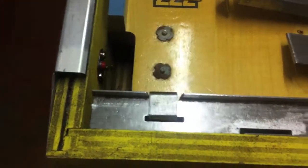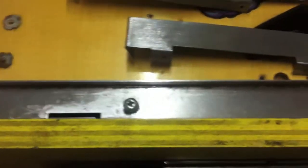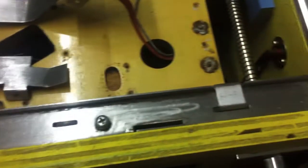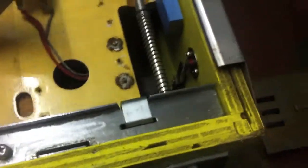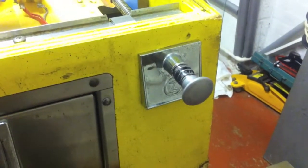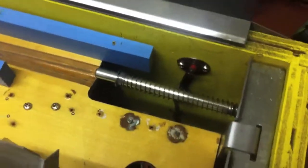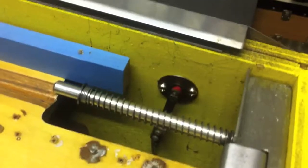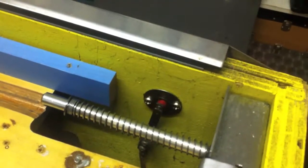I've also done the lock down bar and the brackets. There was quite a lot of rust on the lock down bar assembly — that's all gone. I also took the shooter assembly apart and did the same, chucked all the bits in the tumbler and cleaned those up a bit. I've also stripped the flipper buttons down on the start button, cleaned all those up and put those back on as well — so they're sorted.